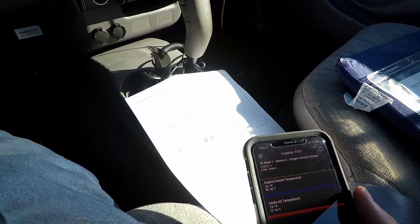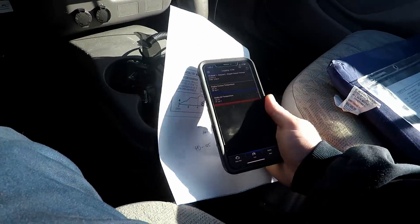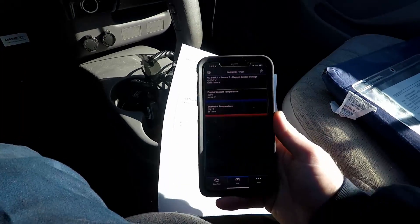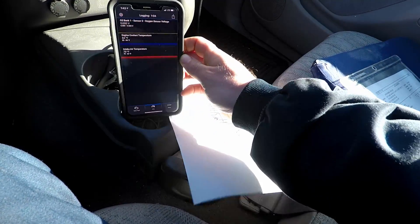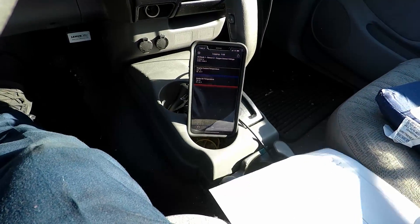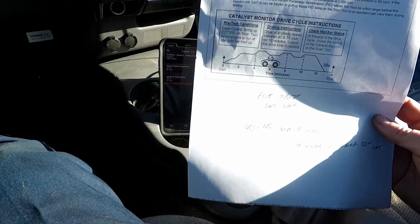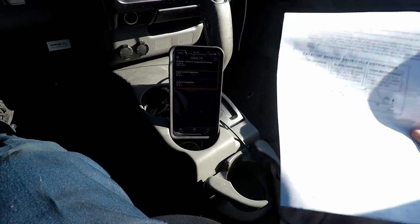I checked two different sources. Normally I use Direct Hit as well as a Motors guide for drive cycles. All Data is kind of iffy sometimes, but I use them as well if I can't find anything. The second source said that it just wants it to be higher than 167 degrees. So I've got some notes here on how to drive it and what they want for the catalyst monitor. Let's get this thing rolling.